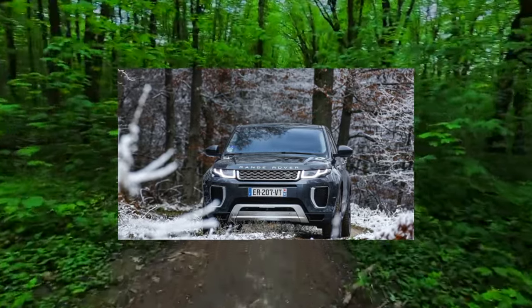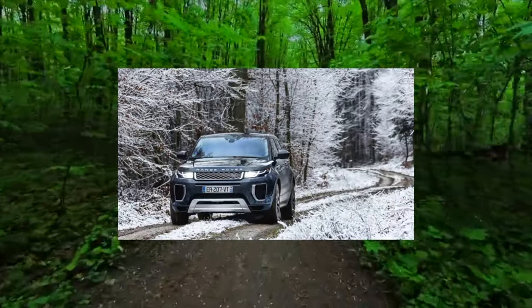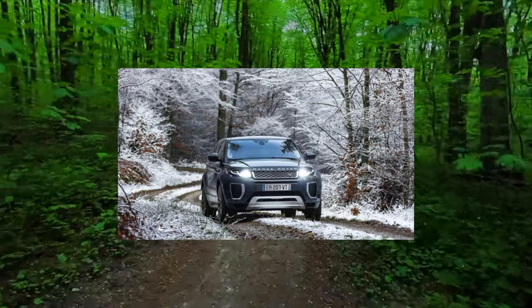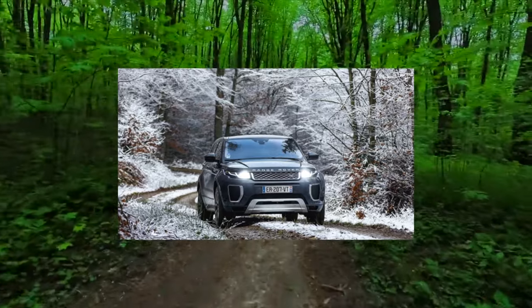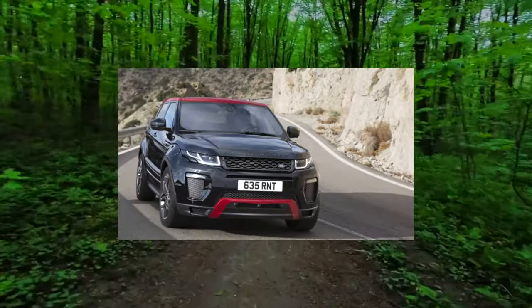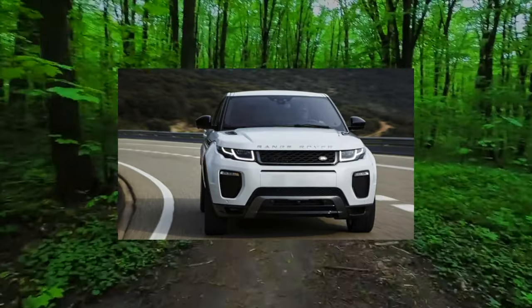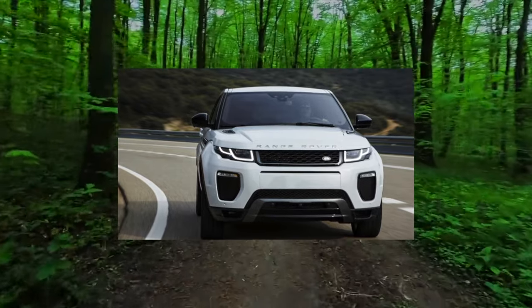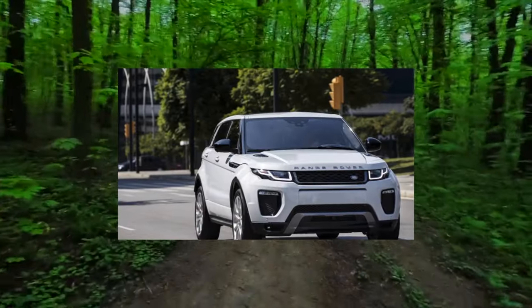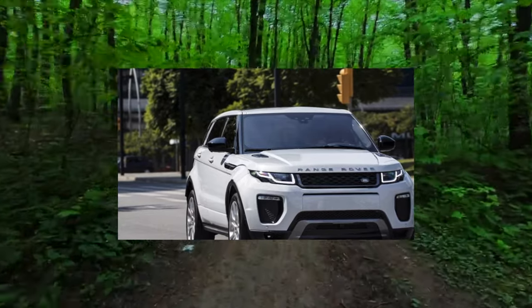If you have an endoscope, try to inspect the cups of the rear suspension mounts — there is usually surface rust. Even on the Freelander 2 platform, perforation rarely appears, and on fresher and better-painted Evoques the problem manifests weaker. The quality of corrosion protection here is higher than is now accepted on mass brands, but still does not reach the level of late-1990s cars. There is no complete coverage of the bottom with anti-gravel compounds — the metal is covered with plastic panels, the seams are protected, especially the problem areas. If the car was used only in the city and was serviced by a dealer with regular washing of the bottom, then the condition will be very good.